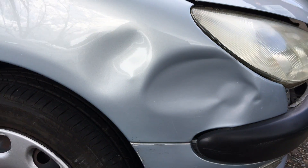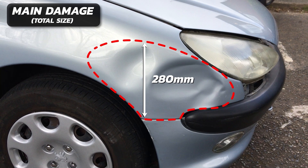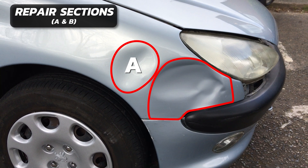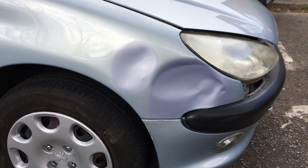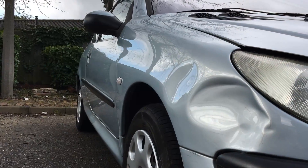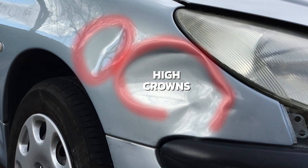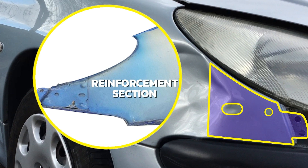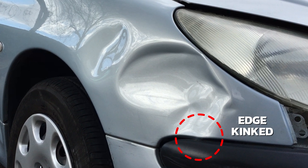Moving over to the right-sided wing or fender, we can see that this damage is a lot more complex and covers an area of approximately 400 millimetres by 280 millimetres. This damage can be broken down into two main areas — section A and section B — both similar in depth at approximately 35 millimetres. Dent B has quite a deep crease running in a curved shape over the top, and we can see the high crown areas of both dents running around their perimeter. The tricky part is there is a reinforcement section behind the panel which will definitely cause some access issues, and similar to the other side we also have a kink at the lower edge.